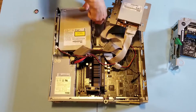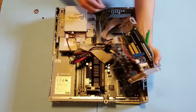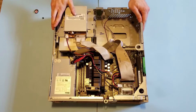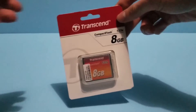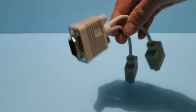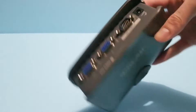Changing the battery is easy as that, and now it's time to put everything back together. Let's connect the CD audio to the sound card, and the power and IDE connector to the compact flash adapter. Everything slots back together nicely. For this machine I bought a Transcend compact flash card, only because it showed up in suggestions as what other customers were buying with the adapter. I've heard negative things about these cards since then, but in my personal experience this card seems to be working just fine. Also, I learned not to use a passive VGA splitter as it messed up the colors and BIOS display.